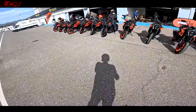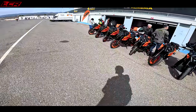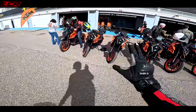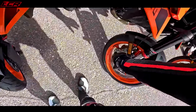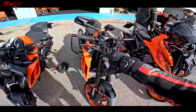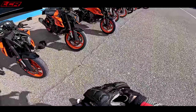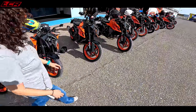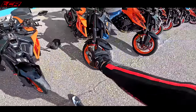But just had the briefing in there, and basically they're saying the 990 is 96% new over the 890. So really, it's a completely new motorcycle. I think the only carryover parts are the brakes. So the brake system and the brake master cylinder are the same as on the 890 GP, let's call it. Not the 890R, of course, because that had the Stylemas. So this has got the same brakes as the 890 GP, but even they're not exactly the same. The carriers are different. So I think we've got half a kilo saved on the carriers.